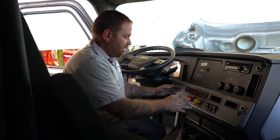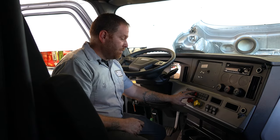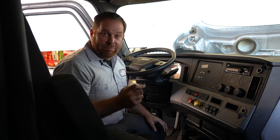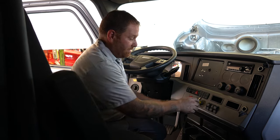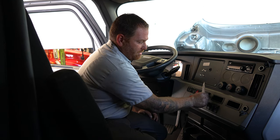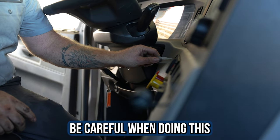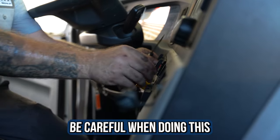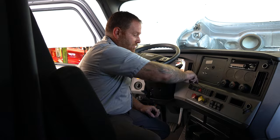I'm in the driver's seat, and right here is your MSF switch. As you can see, there's a hazard right in the middle. You can use a flathead — I'm using a switchblade because I carry it with me at all times. On each corner there's a little tab. All you're going to do is pick it out just a little. Don't go crazy and dig it into the dash — all you've got to do is pull out the tabs. Right when you get that tab, stop. Don't start pulling. There's also one in the middle, which is your hazard.